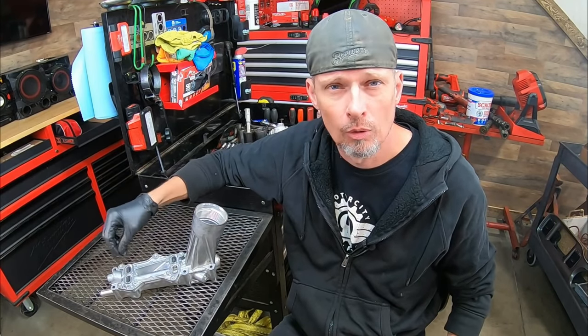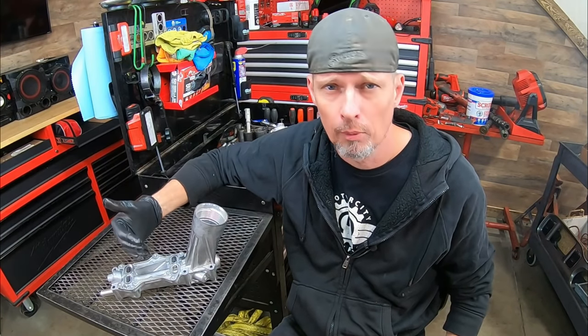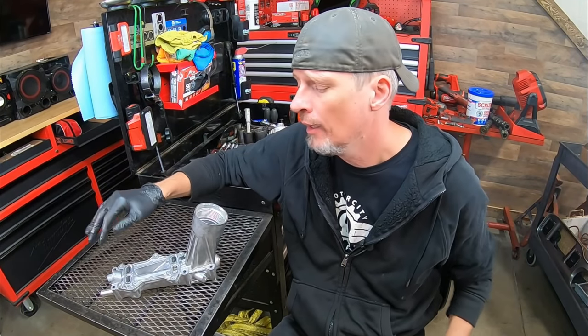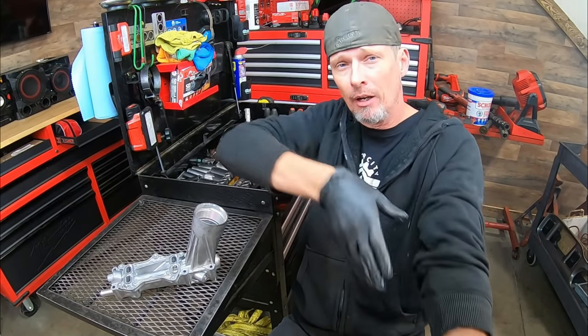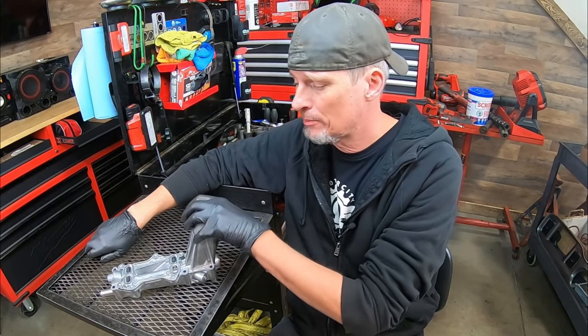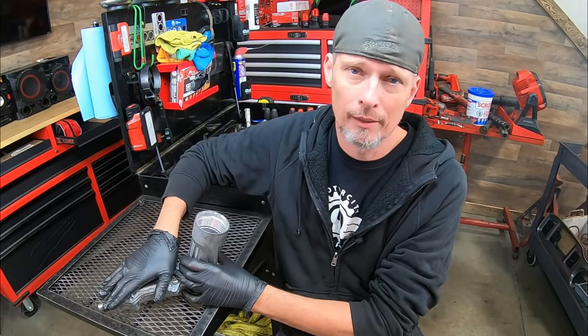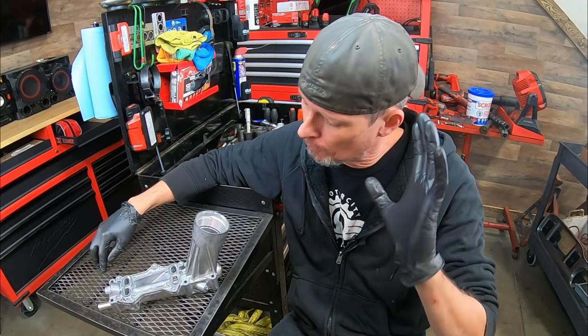Last but not least, the oil cooler assembly. Remember I told you we can have external leaks — oil and coolant — but we can also have an internal leak. If you ever open up the radiator cap or pressure tank and you saw oil in there, it was because of that cooler. As you can see, the Dorman part doesn't come with a cooler — we're robbing that off of the old part we took off. So in the future, it's probably rare it will ever happen, but if that oil cooler ever leaks internally, they don't sell it separately, so you're buying an OE replacement assembly. At that point, are you going to swap the plastic back in because it comes complete, or take the plastic, rob the cooler off, and bolt it back onto this? That's up to you, but something to take into consideration. You will probably never have that problem, but I want to throw it out there.